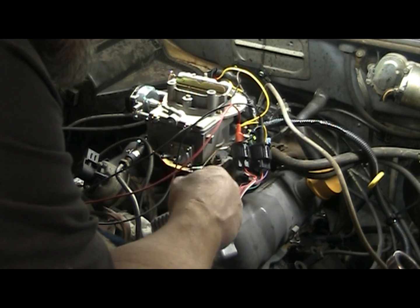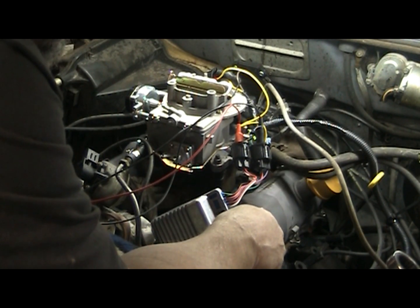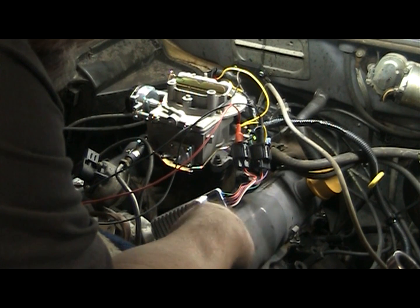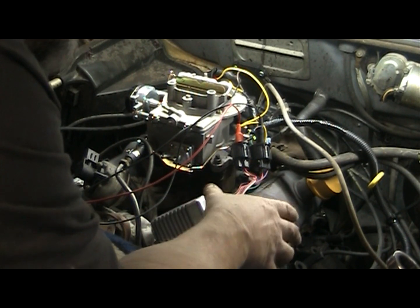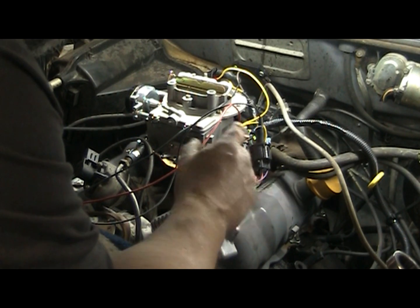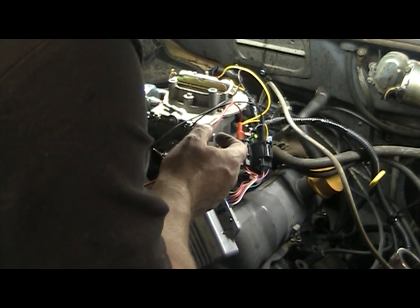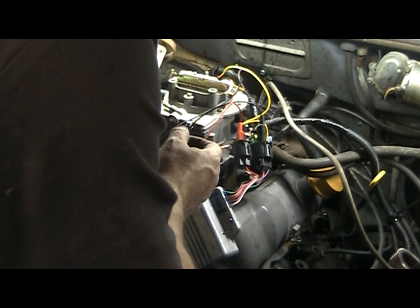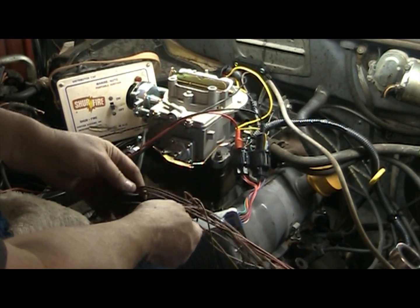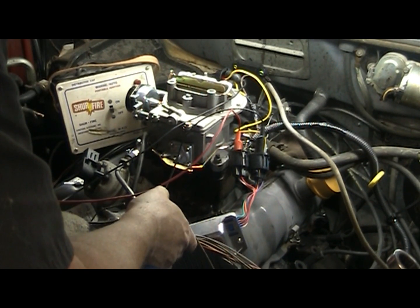This is part 2, and I'll button everything up here. I've got to put antifreeze, got to put some new coolant hoses, I've got an alternator and everything. Basically just the cylinder heads are on — intake, carburetor and everything. Carb runs fine, sounds like it's doing good. I do need to add power for the choke, somewhere in this mess of wires, so it'll open up. And I think after that we should be good.